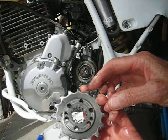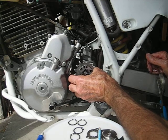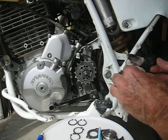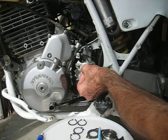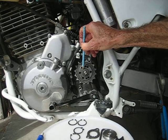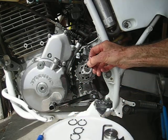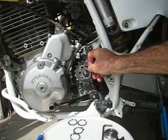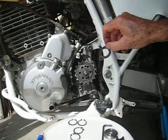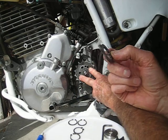I've got about 12,000 to 13,000 miles on this thing. I'm installing this just like I normally would and wiping off a little bit of the extra grease. Now this face here of the sprocket is flush with the inside face of the groove, whereas Honda uses a cheap little flange held on by two bolts that doesn't even captivate the sprocket well. My system holds it with pretty much zero clearance against those spacers I put back in there.